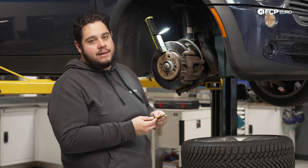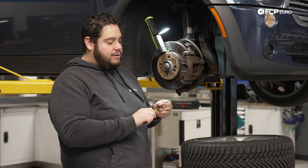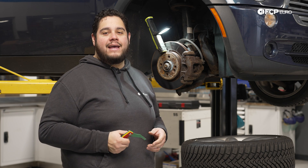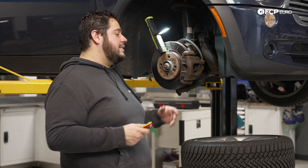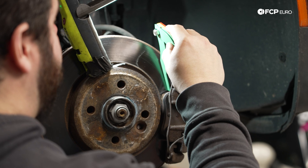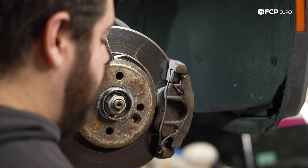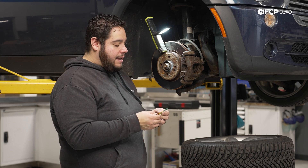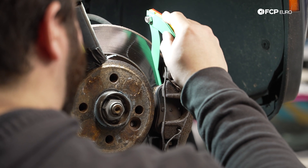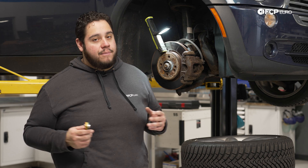12mm being the greatest is going to be brand new — no need to change. In order to use one of these gauges, take a look at the vehicle and see what you have going on. I'm going to start with the 10mm gauge. These are super simple, so if you don't believe the guy at the quick oil change shop or the dealership who told you that you need new brakes, you can measure for yourself. Grabbing the gauge, you're going to take the flat portion, butt that up against the surface of the disc, and try to get it between the disc and the backing plate of the pad. In this case, the 10mm is too big and doesn't fit in, meaning we have less than 10mm of pad material left. Going to the 8mm, that one seats in perfectly fine. So we have about 9mm of pad material left, which is well in spec and safe for this car to continue operating on the road.